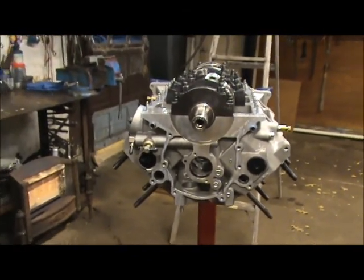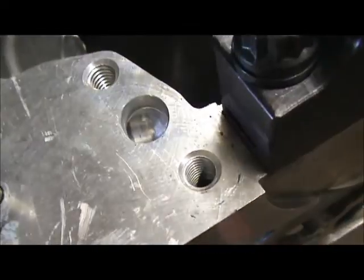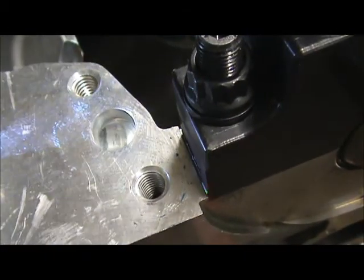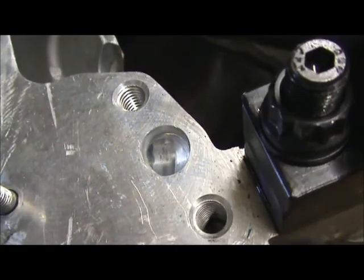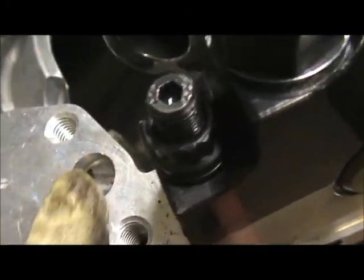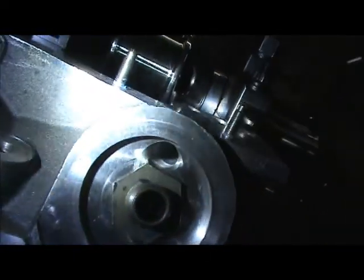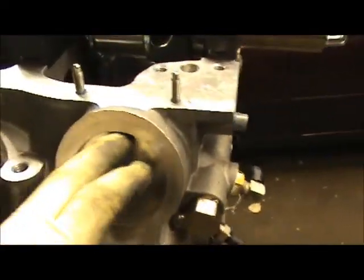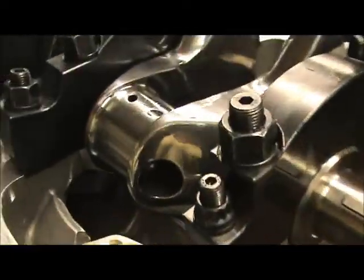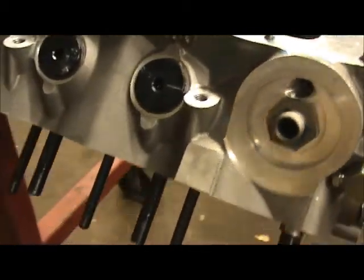You can see some work I've done on this block - that's for your oil pump, it's your pressure feed side on the oiling system. From the factory it had a burr inside there and I ground the burr out with a die grinder very carefully. I ground that out with the die grinder too - cleaned it all up and made sure the oil was going to flow through here real nice. You've got to make sure the oil flows through here real nice.